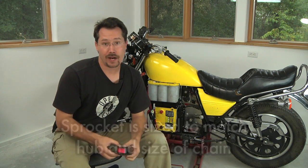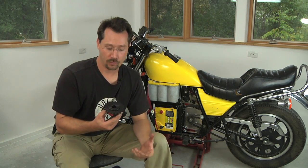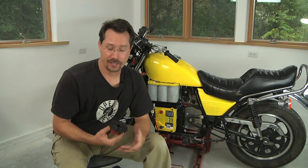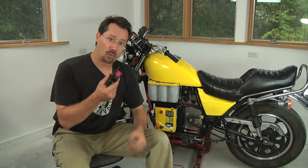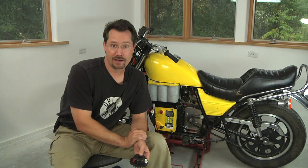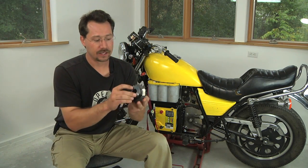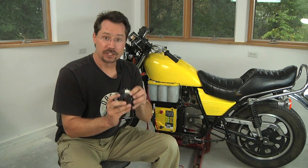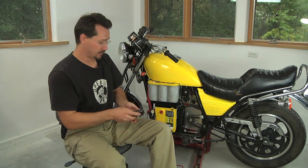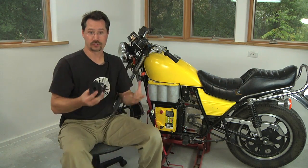When I started this project, I didn't have a welder or any welding experience, so I just took these two pieces over to a local welder and had him weld that on there, and I was done with it. Once this is a single part, you'll be able to slide it onto the drive shaft of the electric motor and tighten it down using a square key and two set screws. You might also want to use a little bit of Loctite in there as well. So that's just going to go right onto the electric motor.